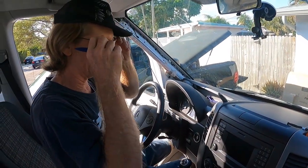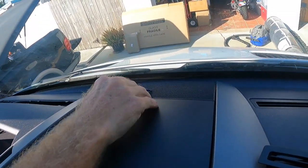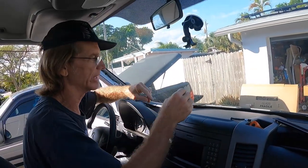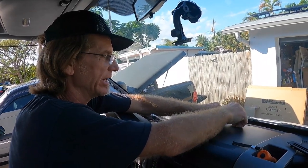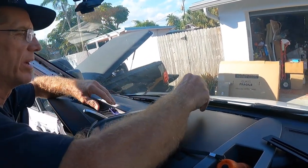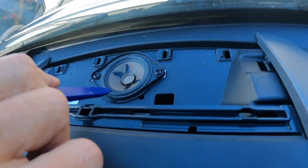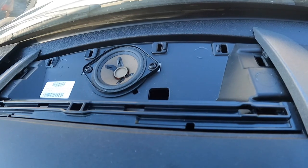One of the things that Mercedes has with their factory radio is a center speaker. That helps with radio calls, phone calls, the vocals, things like that, but it's not good with the stereo. So you take your panel tool, pull the cover off, you see there's a couple screws, pull that speaker out and disconnect the wires from that speaker and it will enhance your stereo sound.